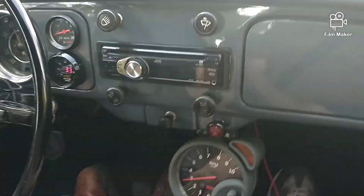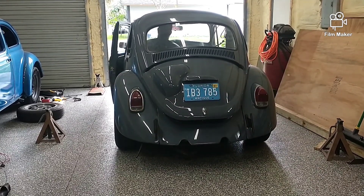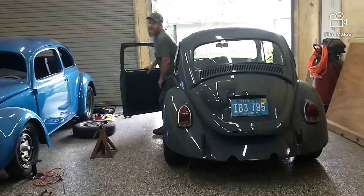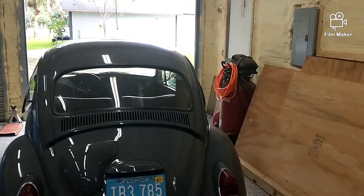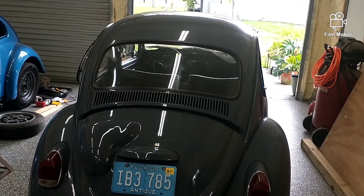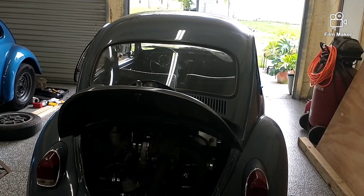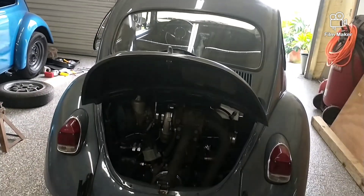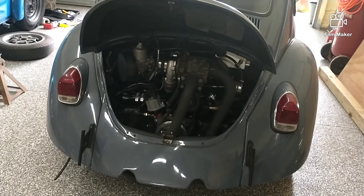Reading 11.8 on the AFR. Well, it runs — pulley scrapes, of course — but it's in there and we need a bigger carburetor. It doesn't run lean now though; that fuel regulator did work. On the single port that did run lean, but we're getting there, one carburetor at a time. Don't forget to like and subscribe and we'll see you guys later.